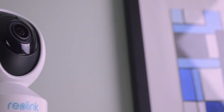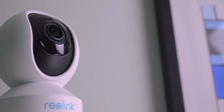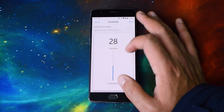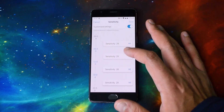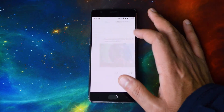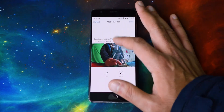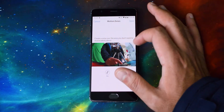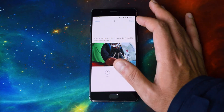Buying this camera will depend on whether you want to go through those workarounds or whether you just want a plug-and-play camera. As for resolving the light change issues, a way I got around it is reducing the sensitivity and also selecting which areas I didn't want to trigger the camera — obviously the areas where the light is going to be changing, like on the ceiling where light usually shows up and triggers it. On the other hand, this does reduce the security, and it's up to you whether you want to take those risks.